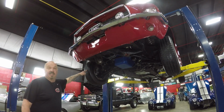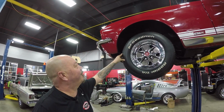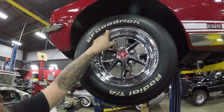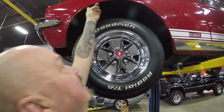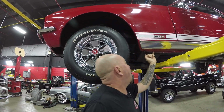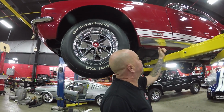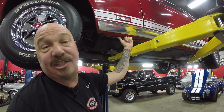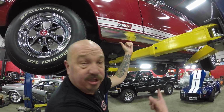Let's look at these wheels and tires. All right, up front here, we got some great looking style steel rims, 205 70 14s up front. The lips on the front fender looks good. Always check in here. This is where these babies rotted out first. And I tell you what, all I feel is nice smooth metal back there. Let's look at the rear.